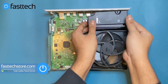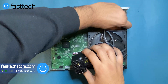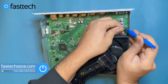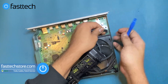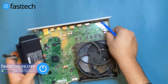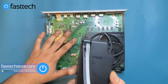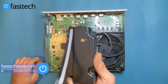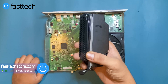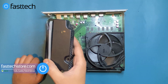Next, we're going to remove the power supply. We should be able to just lift it out at this point since all screws have been removed. There's a clip underneath on the plug — we're going to press that tab with our pry tool included in the Fast Tech Toolkit, push the clip down, and pull out the connector. If your Xbox One isn't turning on — no beep, no sound, no light at the front — about 70% of the time that means you need a new power supply. We did a video on this on our channel.